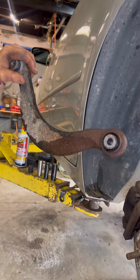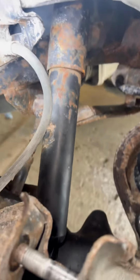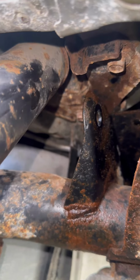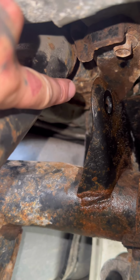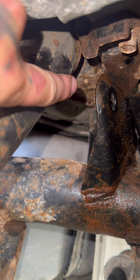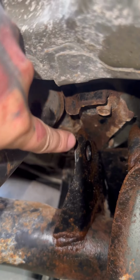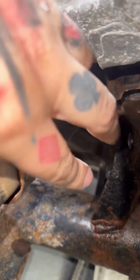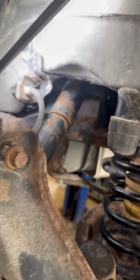There's the control arm. Hand. What? Yeah, we got lucky on that upper bolt. Bottom bolt we had to torch off, but you can see how tight the area is right there. So flex head, thin, ratcheting wrench works great. So that bracket, when we put it back in, this whole bracket goes all up in it as one piece with the shock attached. Dumb design, but whatever.